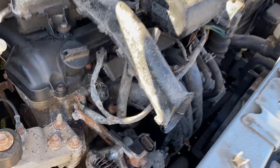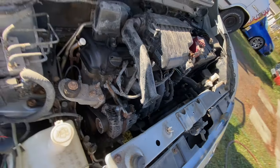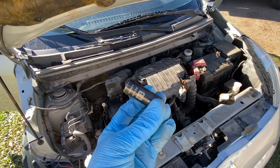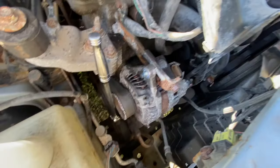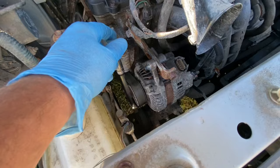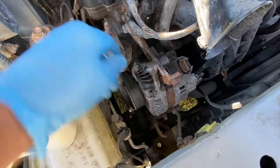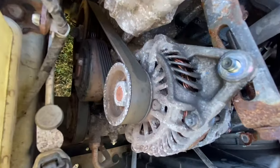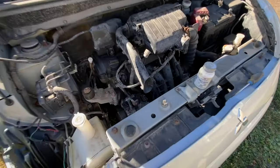Okay, that's removed. So now watch — there's the engine, and right underneath here, see that? That's a 14 mil. You need to remove that. The way you do it is with a deep 14 millimeter socket on a ratchet — you can get in there perfect. Go ahead and remove that nut as well. Both of those are removed. See, this is so easy, anybody can do this.